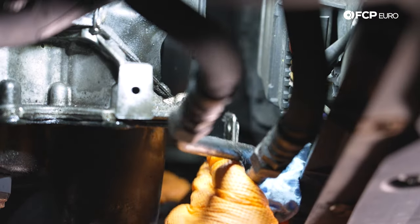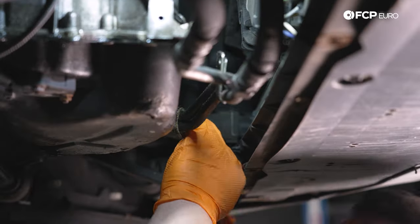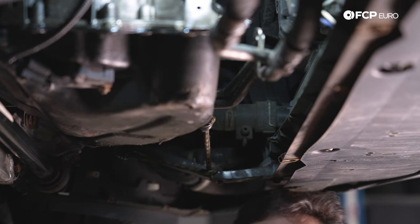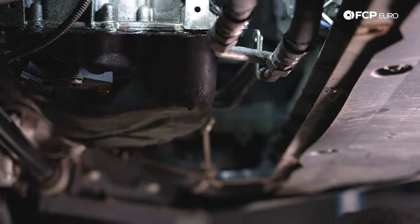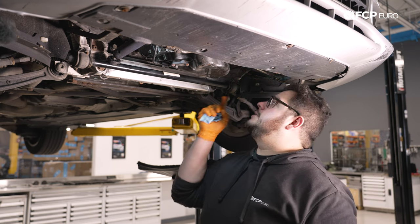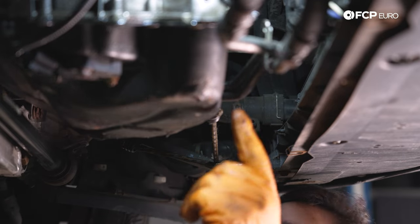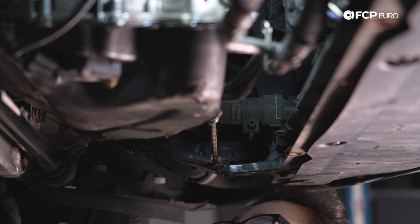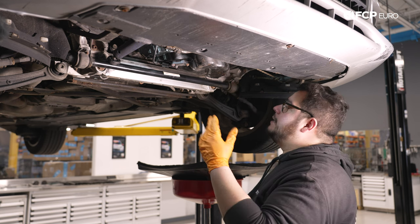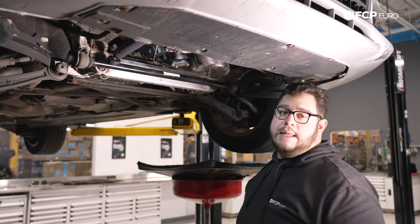Now that's going to give us some play in the lines. We're simply going to bungee cord them from somewhere here and wrap them on the driver's side of the car — something like that should be okay. If we need to, we can add a second bungee cord or a zip tie and move them out a little bit more. Now that we have that situated, the next thing we're going to do is take a look at the pan. We're going to have to use a different combo of T30 sizes. Some are super accessible with an extension; some you may be able to get with a swivel and some you may need to go super stubby. There is an anchor point on top of the block which you can use to raise up the motor a bit if needed.